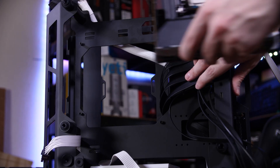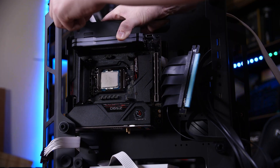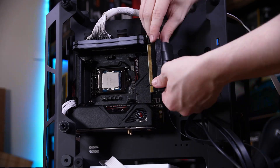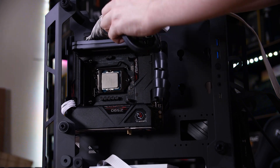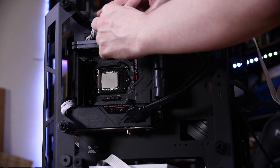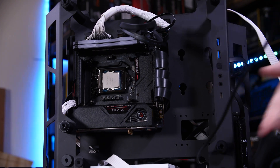Once that's all done, it's time to install the motherboard. The case already has all of its standoffs pre-installed, so all you need to do is line up the four standoffs with the four holes on the corners of the board and install screws in all of them. Then connect up your power connectors: the 24-pin, front panel connectors including USB 3, the front panel power connector, HD audio at the bottom right, the USB Type-C connector at the top left, your 8-pin CPU power connector, and of course the PCIe riser that we'll use to have our graphics card out at the front.